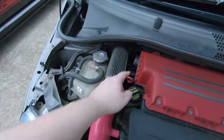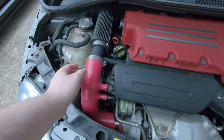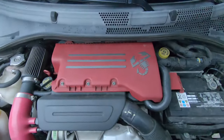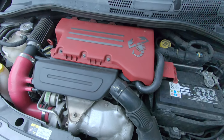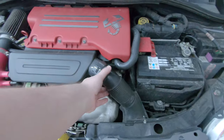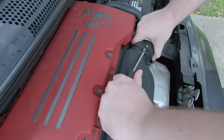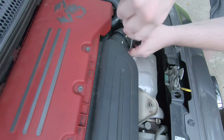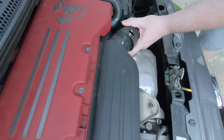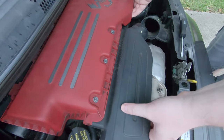The map sensor is actually located back down in here somewhere. George has an aftermarket intake on it, but still has the factory airbox, so we've got to pull the factory airbox off. That is relatively easy to do. We have to disconnect this little intake hose right here — it's got three little clips on it. That pops off just like that, and then this guy just pops up.